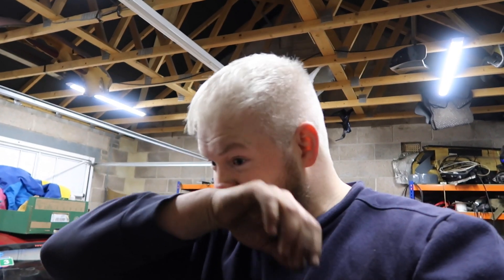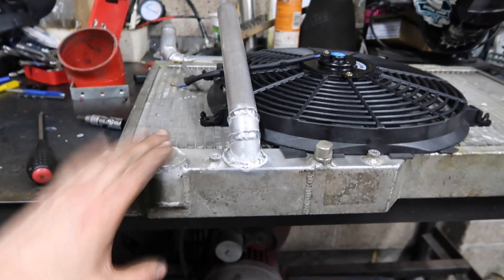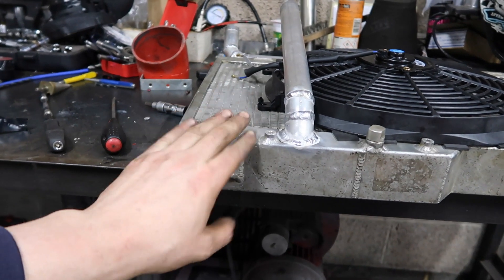It works — works a treat. I always run rad weld in the RX-7 and I've never had an issue. What I'm going to do is clean up this wire wheel a little bit, and then I'm going to set up the TIG for aluminium, and then we're going to start on this. This can be my practice piece because it's kind of underneath the car.